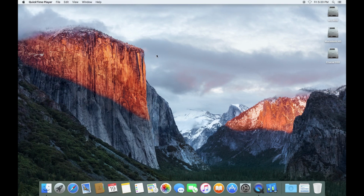Well, we are back, and yes, that was a tremendous difference in boot time. Mac Pros will always tend to boot up slowly, particularly if you've got a lot of drives in there, and mechanical drives especially, because they've got to spin up. It just takes time. So you get, I don't know, maybe 20 seconds before you even get the boot chime. Even with that in mind, booting off the hard drive, I assume we're booting off the SSD now. Booting off the hard drive just took a long time.